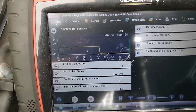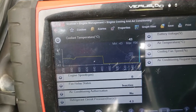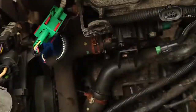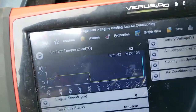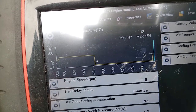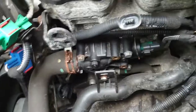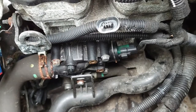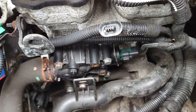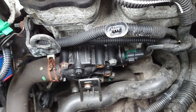Just a quick note here — I'm reading a minus 43 degrees. Usually you'll see some sort of ridiculous reading when things are open circuit or short circuit; it'll either be completely maxed out or completely negative. We've got it disconnected at the moment reading minus 43, and when we plug it back in it should go back to a normal temperature — there we go, back up to 12 degrees. Another test you could do with the plug disconnected is a continuity test across the two pins in the sensor, but that's awkward to get at in some places, so the bypass test with the decade resistance box is preferred because it proves so many things at once.